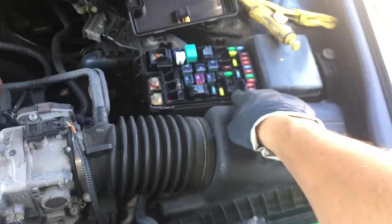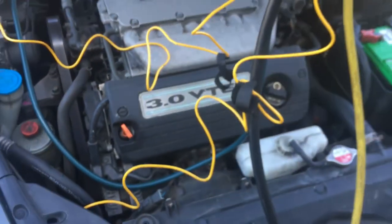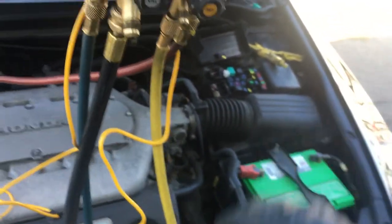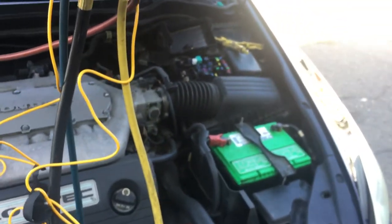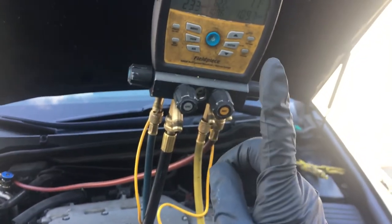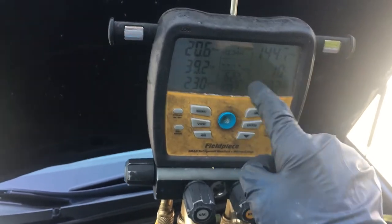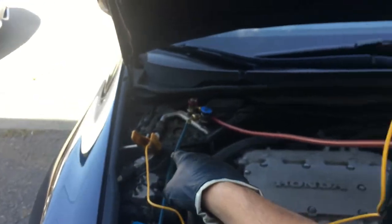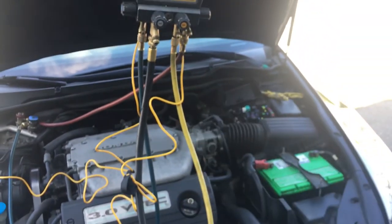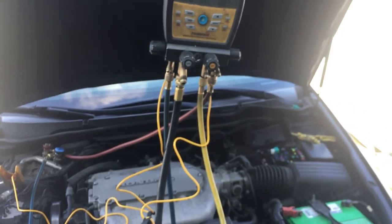We've got 143 degrees because we only have one fan moving — I sacrificed a fan relay for the AC. I didn't jump right to a scanner like people who waste your time and sell expensive relay-checking kits. I give it to you fast, free, and simple. There will be a part two where I'll show you the difference in superheat and the suction line temperature after I do a recharge. I'm about to throw this on the recovery unit and show you the after effects.